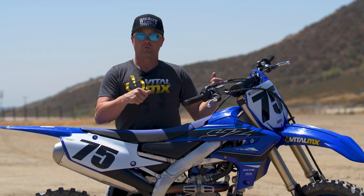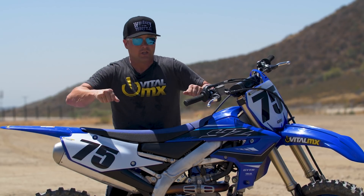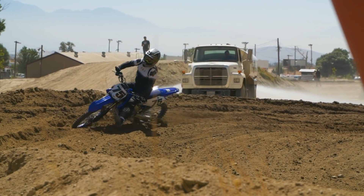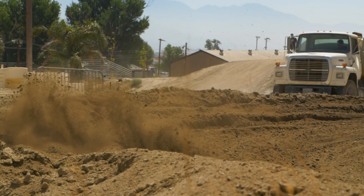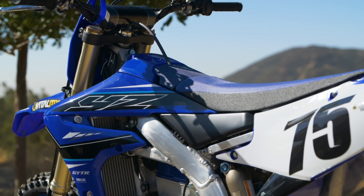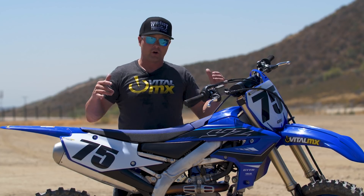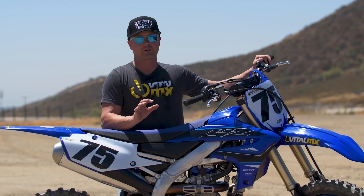When I go to any of those forward positions, I feel like I've got too much weight on that front tire. When I go from accelerating to off the throttle, I get a really nervous feeling in the front. As soon as I bring it back to the rear mount, the problem goes away — it's a huge difference. If you're having that feeling like your front end is nervous or wants to tuck, try bringing your mounts back to the rear position. There are essentially four mounting positions, and I'm in the second from furthest back. If you're tall with longer arms, the forward positions might work for you, but definitely give those a try — it makes all the difference in how this bike handles.